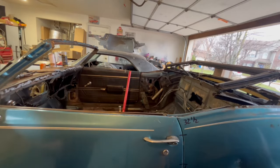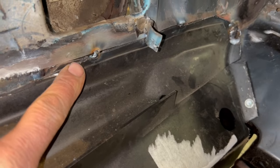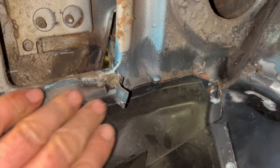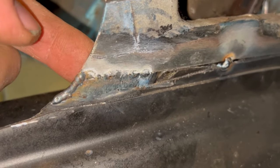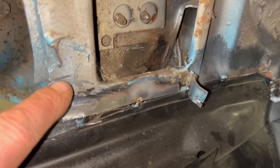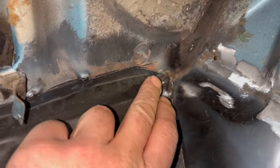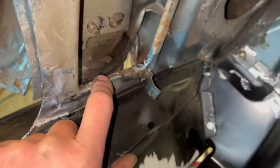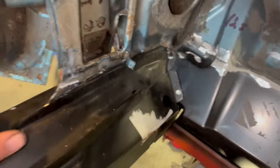On the front, I made a little wedge-shaped piece of metal. I've actually welded on the other side — welded almost all the way through. You can see it wedges all the way in here. That's going to take care of that little mess up I made. I'm going to come through here, burn it in kind of heavy. I like a little bit of a gap because this is heavier gauge than your outside sheet metal, so I want the weld to fully penetrate. The weld on the back side came all the way through and filled in the gap completely. I've also got to weld this shut where someone got a little carried away with the cutoff wheel — that was me. I'll do a nice butt weld clear through, fill in here, then three spot welds here. I'm going to try to get down inside there and do those little welds into this brace into that rocker panel.